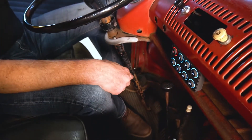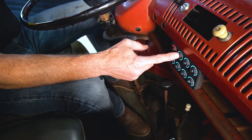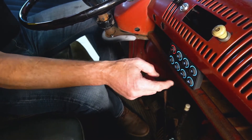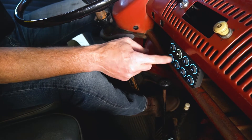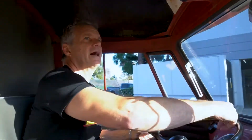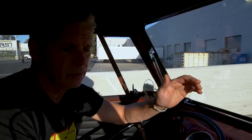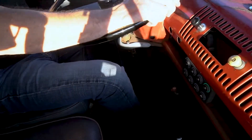We got a couple of steps to boot it up. We're in park. As I hit this, the green light actually comes on — that's telling you we are now up and running. If I don't have my foot on the brake, Sam wired in a zero-to-five-volt signal off the brake pressure, so the VCU is looking for brake pressure. If I'm just sitting here hitting buttons nothing's happening — it won't go into gear. Awesome safety feature. Now with some brake pressure on it, I hit reverse, it goes into reverse.